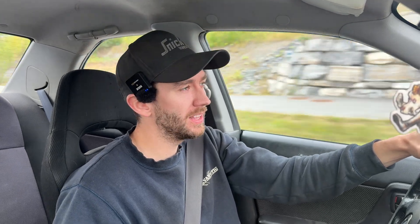So, how did it go? Well, the bushings are on the car, and I have to say, they feel great. The car feels more planted, no more skipping, no more of that kangaroo feeling — it just works, and I actually can't believe it, but yeah, it seems to work. The scale of hardness that polyurethane is measured in is called Shore, and the filament I used was 95A, which is pretty hard — much harder than your regular polyurethane bushings. So that's something to consider. It does feel very stiff, but since the rest of the bushings are softer, it compensates. It feels good.